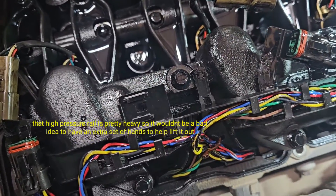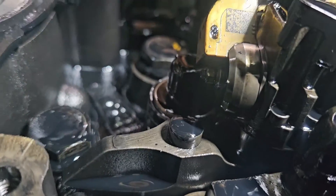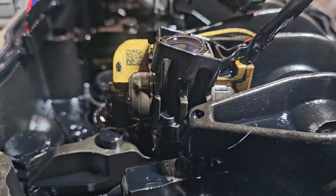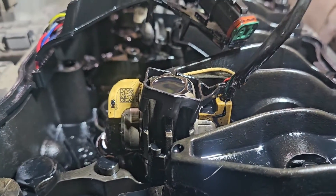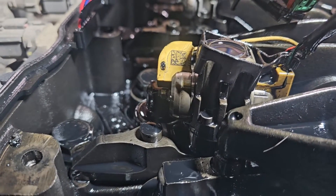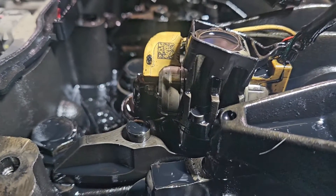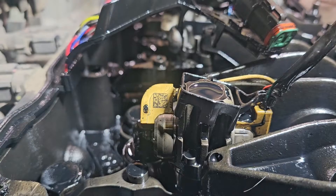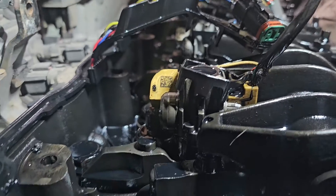When pulling your injectors out, there's a torque bolt with a little horseshoe collar — loosen that as you're taking it out and watch the injector lift up and pop right out. Blow it out, and when you set the new one in, make sure you orient it the same way the old one came out. Put the horseshoe bracket into the collar of the injector, screw it down, make sure the injector is seated right, then reverse the process to reassemble.